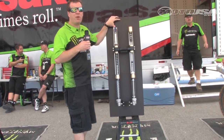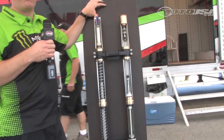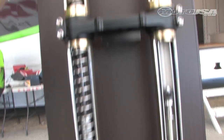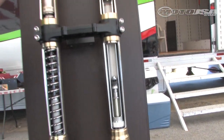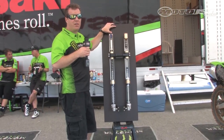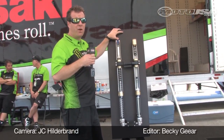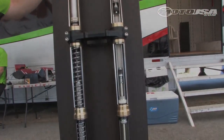Similarly, with the right side, when you want to change your spring rate, you don't have to do both fork legs — you just have to do it on the right-hand side. So you only have to buy one fork spring as opposed to two, and you only have to send in one fork leg — the left one — when you want valving changes. So not only is it a simple system that weighs about a pound and a half less, but the performance of it we found in our testing exceeded the conventional forks we were using previously. So again, the SFF fork from Showa — you're only going to find it on the 2011 KX 250F.